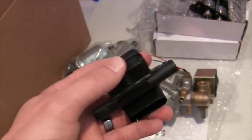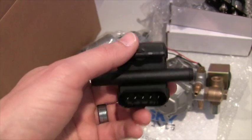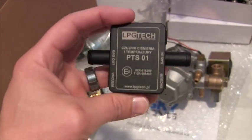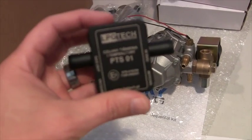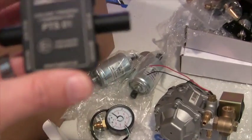Usually anywhere from 12 to 18 inches after the reducer, for a very clean looking engine compartment. Gone are the days of having a temp sensor connected to the injector rail, or an outlet from the injector rail to a map sensor mounted on the side of the engine wall. Fewer wires, fewer hoses — we really like it. And it's going to be more accurate; we've actually found that the readings from this sensor are more accurate.